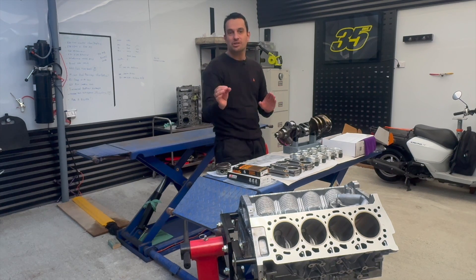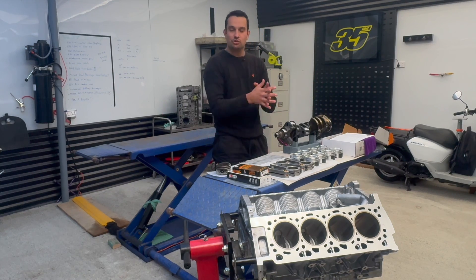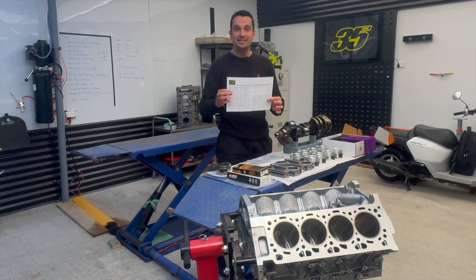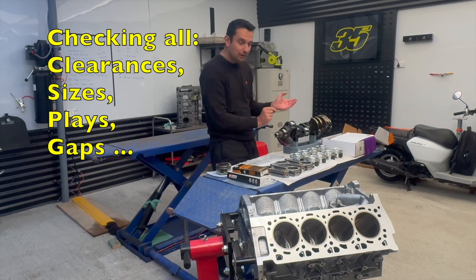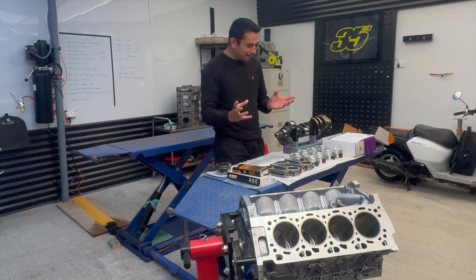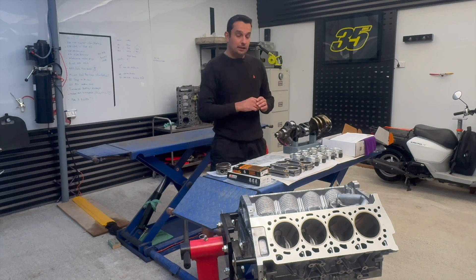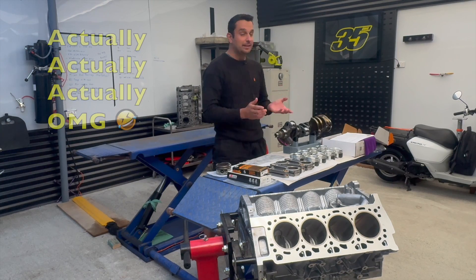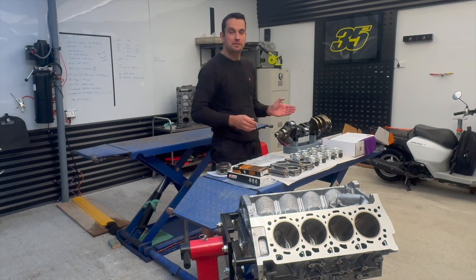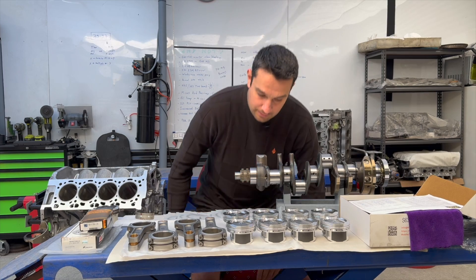In this video I want to share a little bit of the process involved before you actually start building the engine. Some people would just slap the parts together, cross their fingers, and hope for the best — this is not what we do. We like to do something called blueprinting the engine: checking all your clearances — main bearings, rod bearings, piston ring end gaps — and the couple of tiny details that actually make the engine good. If you don't pay attention to those little details, there is potential to grenade the engine later down the track. We prefer to go the extra mile and make sure everything is covered.